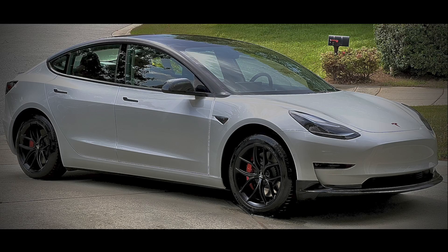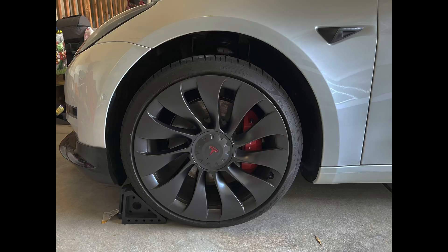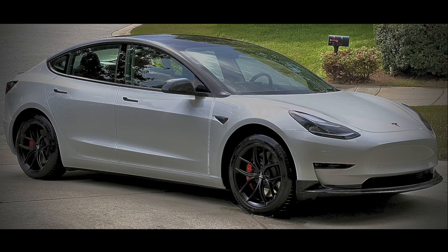In order to maximize your Tesla Model 3's acceleration, you need to precondition the battery to increase battery temperature as much as possible, charge up as close to 100% as you can get, and reduce the size and weight of all four wheels without increasing tire width. Finally, make sure you have it in sport mode with the navigation and AC turned off. Just mash the go pedal from a dig and you might be able to do an 11.271 at 121.79 mph quarter mile in your Model 3 Performance.